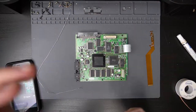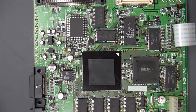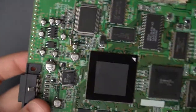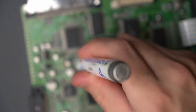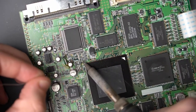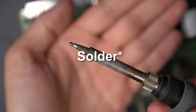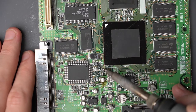All right, the moment you've all been waiting for — let's do this ribbon cable. First thing we've got to do is remove these two resistors here, R9 and R10 right there. A little bit of flux pen, fresh solder, then get some flux on the soldering iron and just go back and forth here.